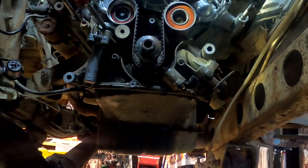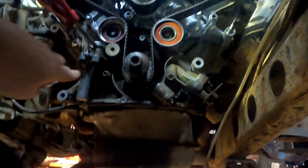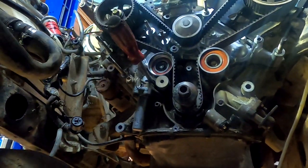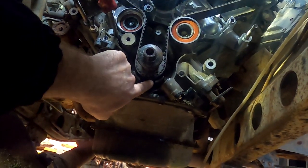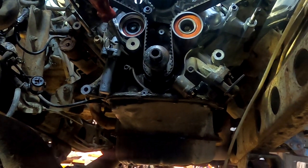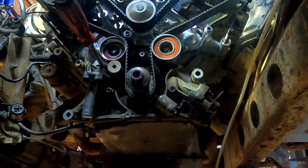Got most of the mud off the front. We put the tensioner in and shoved the screwdriver in like so, and now we can turn it over. A guy the other day was worried because he'd lined up the marks on the belt, and after doing a lap they weren't correct. Of course — they're never going to be correct again until you've done zillions of turns. We check it on the marks on the belt and then check it on the marks on the covers.